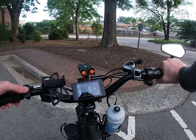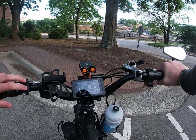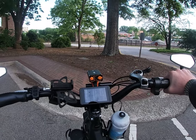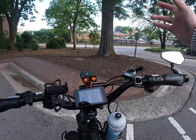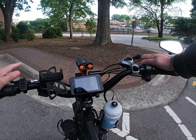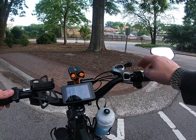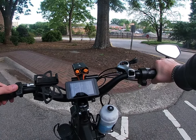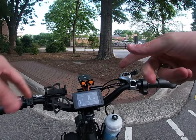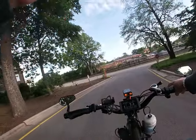The screen is also easy to program. When you turn it off and power back on, within five seconds you just hold down — I think it's up and down — and you're into all your settings. If you're concerned about legality and 750 watts, you can program your top speed so you don't go over the 20 mile-an-hour legal limit. It's super simple — a much better interface. You just toggle through with the arrows. The screen is definitely an important piece of that upgrade.